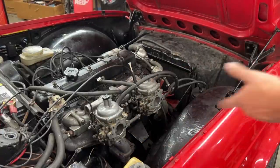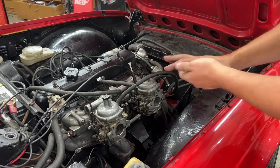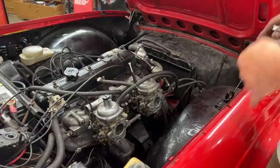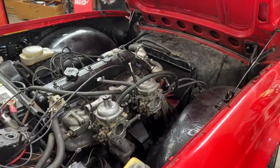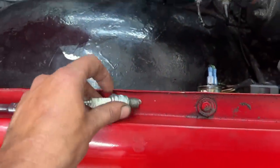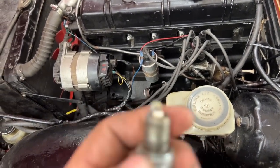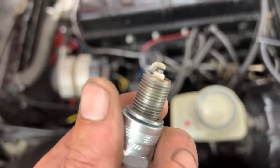Because I don't trust the method where you lift the piston a little bit, the air valve. I just don't trust it anymore. It runs always rich. So, okay, let's go for another test drive. Okay, after another test drive, I took only the first and sixth, and they're still a little bit too clean. We're looking for a little bit of brownish color, and we still don't have that. So I think we're gonna turn another.